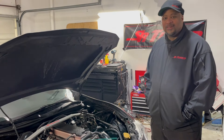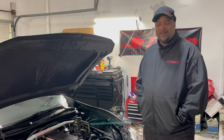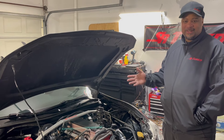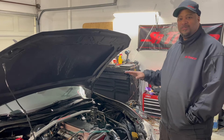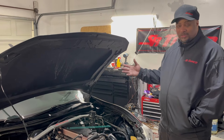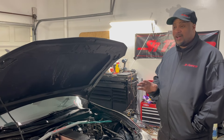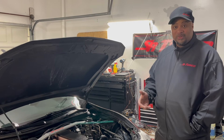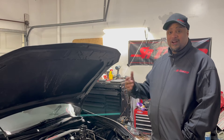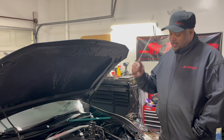As you mentioned cost — I've heard you can run the stock 2AZ ECU and even do a TRD flash tune from the factory at a certain boost level. Is that right? There are some caveats. The way I designed this kit is to use the factory ECU from a Scion TC, and then tune it with a piggyback, so you retain all your OBD functions — you can still scan the car as if it's a regular production car. As far as the TRD tune, that's good if you don't plan on racing. I wouldn't recommend it for racing because that tune was originally meant for the supercharger kit, and superchargers work a little differently than turbos. On top of that, this platform doesn't natively have a MAP sensor, so the TRD tune was based off specific injectors — once the car is in open loop, it just dumps the full load of fuel.